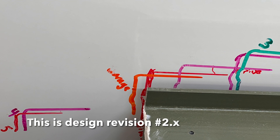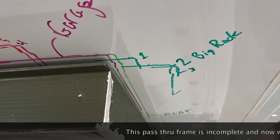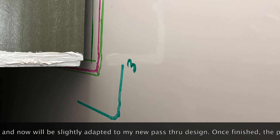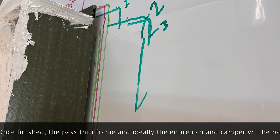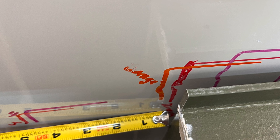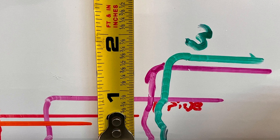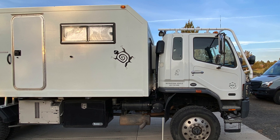Taking what I have now and the new amount of flex I've found, I think I'll use the squared-off frame for some primary seals — putting bulb seals on that — and also glue on some rain drip shields around the top and sides of the camper front wall to shed water away. Then primary seals to keep water and air out as they rotate on each other, with some kind of rub strip. I'll probably do a fabric seal on the inside of the frame that's highly flexible, since it has to flex from roughly eight to twelve inches total length to roughly double that. It not only has to be flexible but also airtight, watertight, and comfortable to crawl over — and of course replaceable and durable. It'll probably have some kind of clasp or magnets to pull it tight, likely on the cab side, though I'm still debating a couple of options.